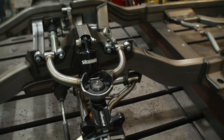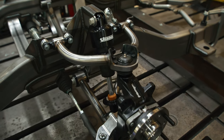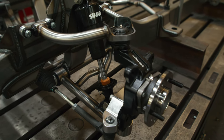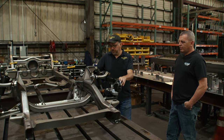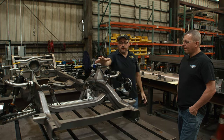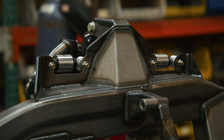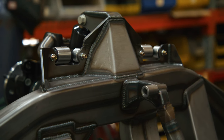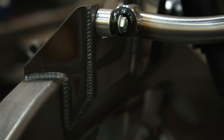Absolutely. With a narrower track width, you can get that more traditional little bit of dish on the wheel, as opposed to sometimes with a low ride height you end up with no dish on the wheel — which was one of the goals. The upper control arm mounting point really was a big emphasis. This is all 4130, really, really stout. Again, it's all about cornering forces and wide tires. Those are kind of the highlights of the front end.